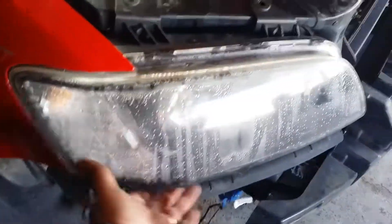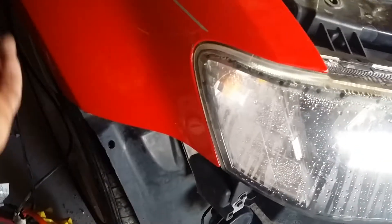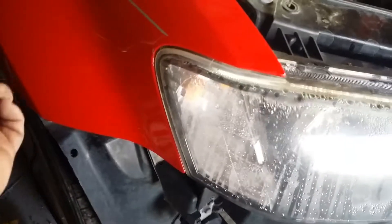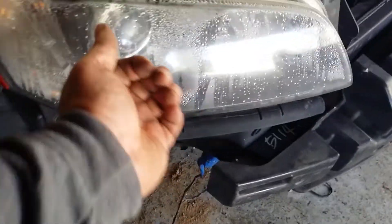The one tricky thing is there are bolts right here to hold the corner of it on, but there are clips that go right here and right here — that's what holds it. The way I got it off, I watched a YouTube video: pull this up, get a little tension on it coming up over the fender, then just kind of wiggle it. I had to wiggle it quite a bit and then it popped loose. Did that on both sides, and of course you've got the push pins in the fender well besides the bolt — this one only had one.